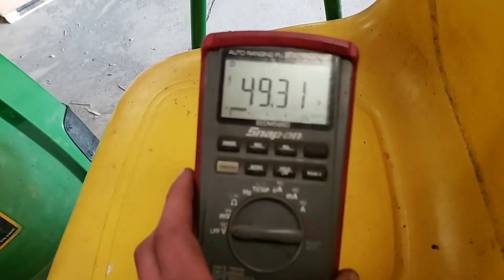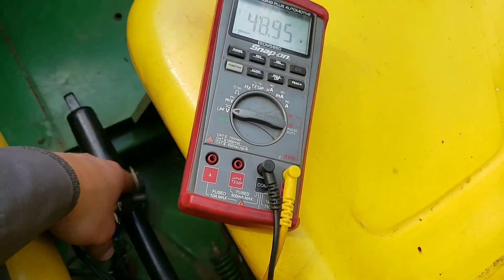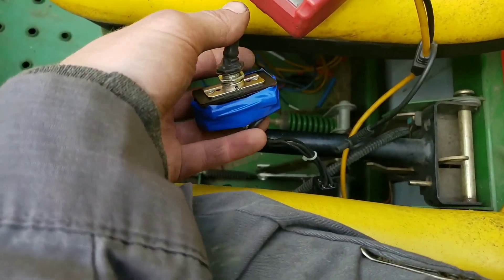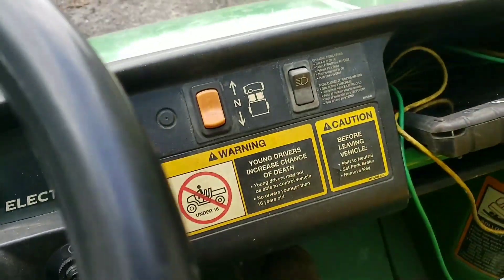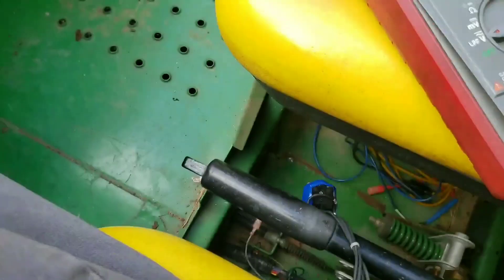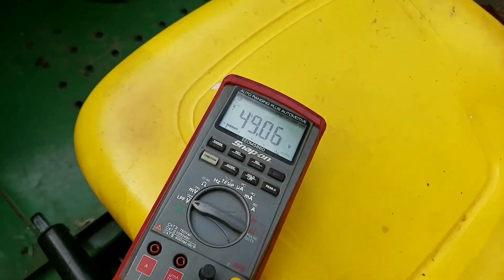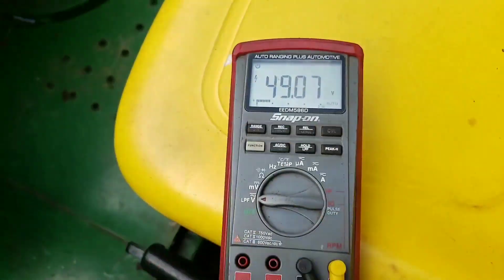We're out here and what I've got is all the plastics removed. We've got our service switch — in this position right now it's in service mode, no pedal, nothing. We flip this switch, fires everything up, it's in drive mode. We're going to come up here, go to forward, and what we're doing is we just want to see if there's any battery voltage drop before we go crazy and start testing electrolyte and go in other directions — if our batteries are good.